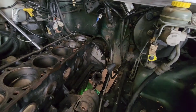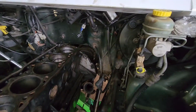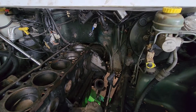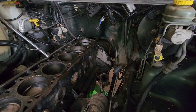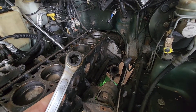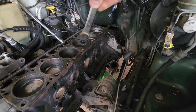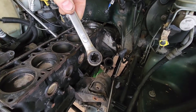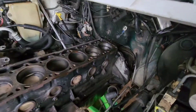It hits the firewall, and if you put universal joints on ratchets and try to get it from further back, there's just no way to hold it and turn it at the same time. So it's kind of a pain. Those bolts will not be going back in there — I'll be putting regular hex head bolts on there, just so you can get something on there. The thing making it most difficult is this star bit doesn't allow for much slippage. It slips off real easy, and you can only engage it in like 10 or 15 degree increments. So it's kind of a pain to get that off.